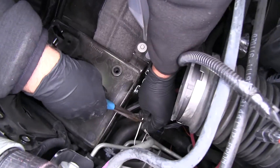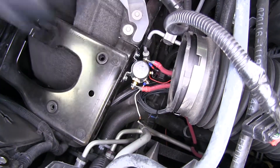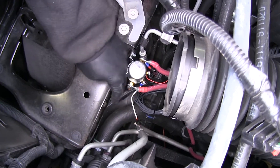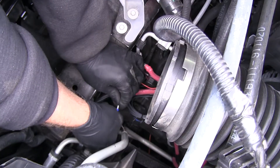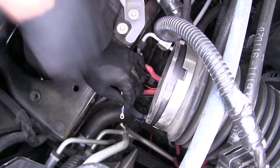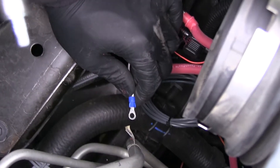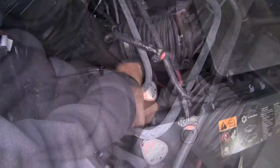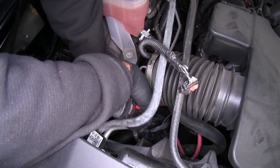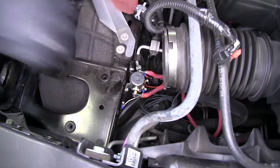The little white wire coming off our disconnect is going to be a ground wire. We want to cut that and strip it back. I'm mounting it right in the same area where we mounted the disconnect. You're going to use the provided ring terminal — place that on and get it crimped down. We'll need a 5/16 inch socket or bit driver, create our hole first and then place on our ring terminal. That should be secure enough so you can't move the ring terminal around.